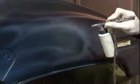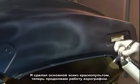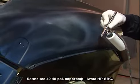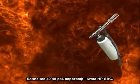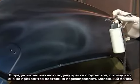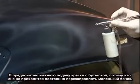I've already sketched a basic pattern with the touch-up gun. Now I'm coming in with the airbrush. I'm checking my air pressure. Usually about 40, 45 pounds. This is an Iwata siphon-fed HPS-BC. I prefer to use this siphon-fed bottle because I don't have to constantly go back and refill.